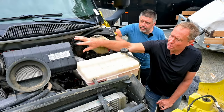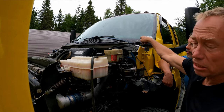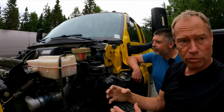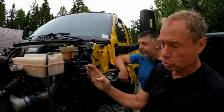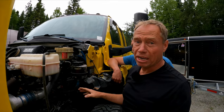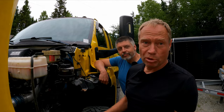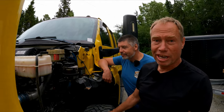Secondly, you'll want to maintain your air filter. On this model, there's a vacuum line that goes right inside to the cab that tells you the health of your air filter. If it starts showing yellow to red, it's time to change it. There's no mileage interval for an air filter - you can get it dirty following one car on a dusty road in a single day, so always keep an eye on that.